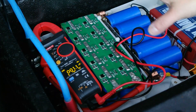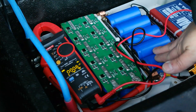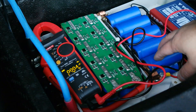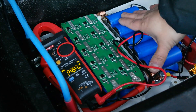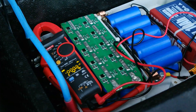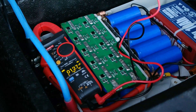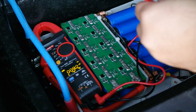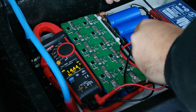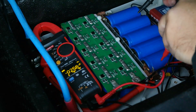While the car is still running, let's also check the balance on the supercapacitor arrays that don't have a balancing circuit, now that they've been running for six weeks. Are they going out of balance or going over voltage? The car's front gauge shows this supercapacitor pack at 14.4 volts. Let's double-check that — positive here, negative here — yes, 14.44 volts for the whole pack.